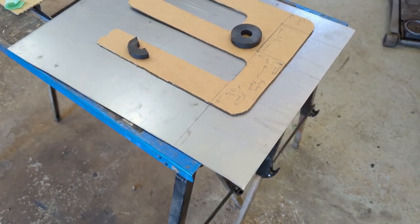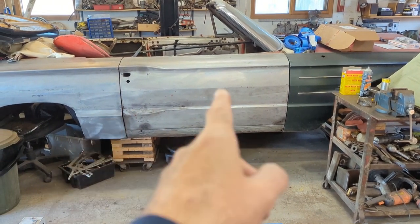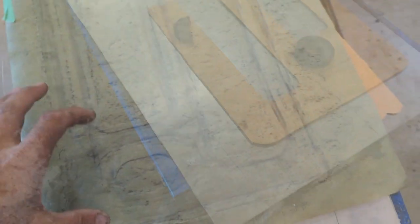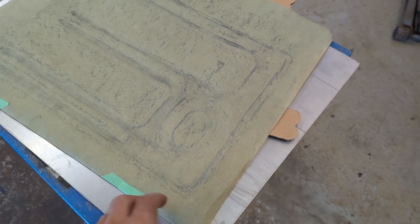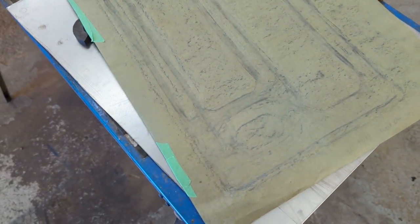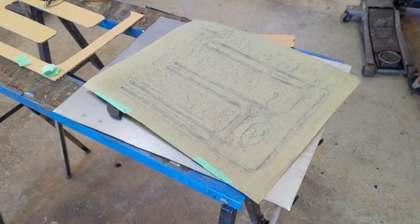I'll keep all that stuff because this one will need two made as well. The back pans are good in this car, but the front ones are gone. So we've got the drain hole, and it drops down around here, so they really bead roll all this out. I'll put it on the English wheel and do a little stretching of that area — the panel will look rough after that, but that's what you're trying to do: give yourself some extra metal before you start bead rolling.